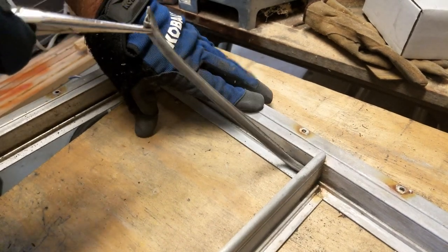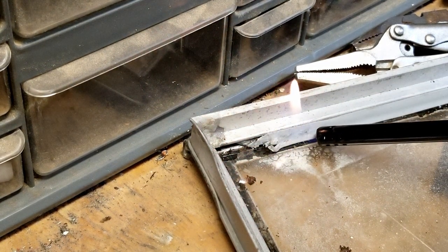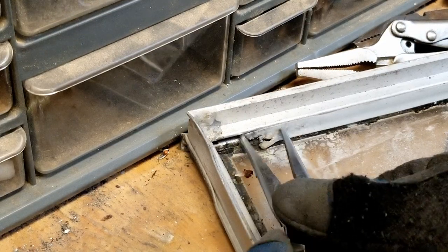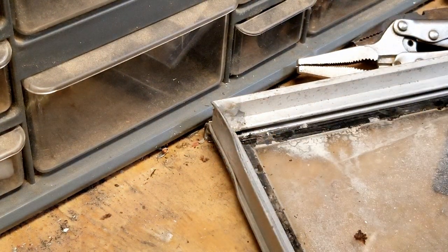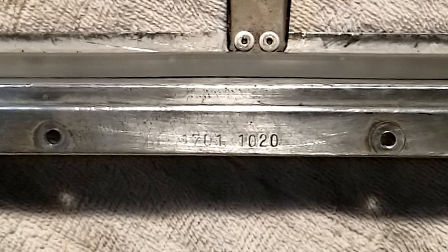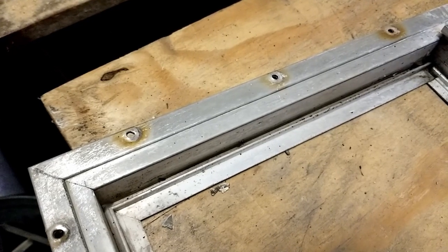Next, you want to remove all your gaskets. Usually if you can get a hold of them, they remove pretty easily. This gasket was giving me fits — it doesn't seal; it just retains the windowpane against the glazing tape, which is your sealing surface. If you just warm it up a little bit, it becomes pliable enough to grab and pull out. Pay attention to what type of gasket you're removing, where it was located, and how it was installed — take lots of pictures and make notes before disassembly. A lot of windows are Hehr (H-E-H-R) windows, and this one had a model number at the bottom. Take that to vintagetrailergaskets.com to identify the exact gaskets you need.